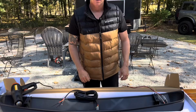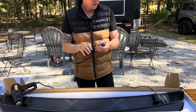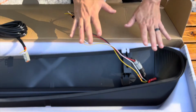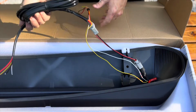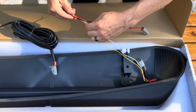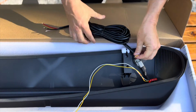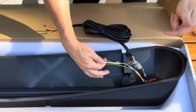Before we get started, why don't we connect the harness for the aux switch setup to the LED light bar before we take it over to the Bronco. Let me point out a few things. Don't get confused when you get the harness and think that you're wiring this to the existing one, because that's not what you're doing. We're actually removing this plug here, pulling out the clearance lights. This is gone, and now we are just substituting, clipping in there, and then we're just going to connect these two wires. That's all we're doing up here, okay? So let's knock that out.